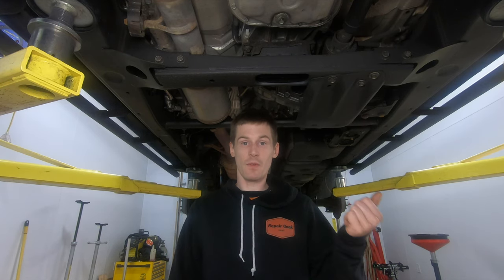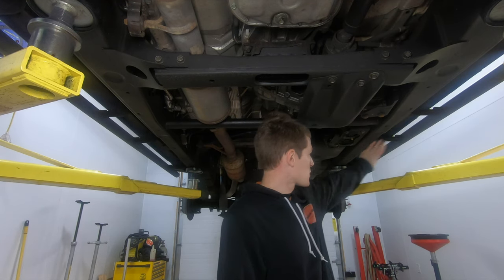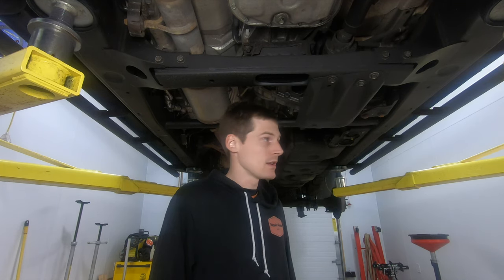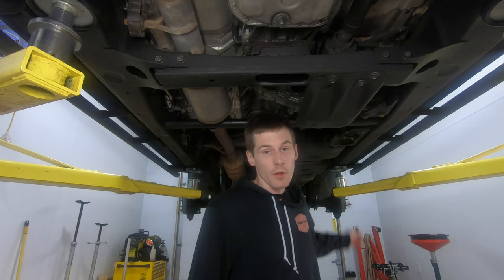What I'm going to compare instead: I bought five gallons of wool wax and five gallons of fluid film. I'm going to take a section of my truck that doesn't have any electrical components — nothing that's going to be affected by a pressure washer — pressure wash off the fluid film, and do the same thing to the other side. We'll start with as bare metal as I can get. There will still be fluid film inside the frame, but any exposed areas I'm going to blow off with the pressure washer.